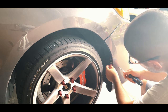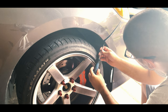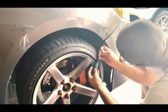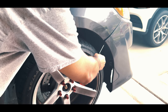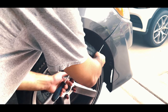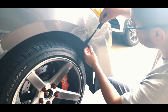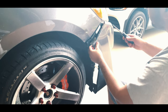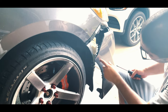Next we'll be removing two plastic clips — one of them requires a flat head while the other requires a Phillips. Sometimes these clips can be a pain, just make sure you have the proper tools to remove them. A quick tip: you should turn the wheel so you have better access to these clips. Once those clips are removed the bumper is held on by a black bar connected to the fender. Be careful when removing the bumper as that connection can break.